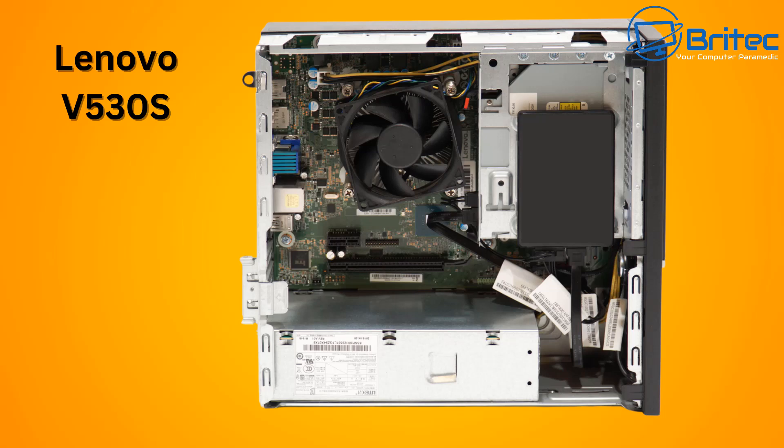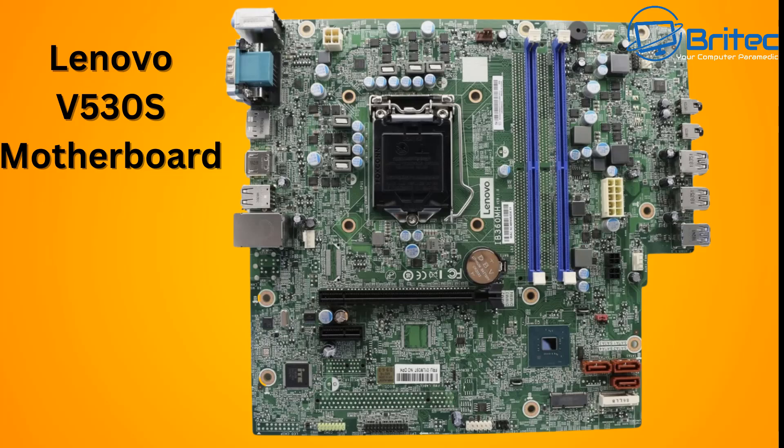If you're looking to case-swap, you've got that proprietary motherboard layout — very few SATA ports, just two RAM slots, a very basic board. There's only one fan header at the top and one in the middle of the board, so you're going to need a fan controller and hub. If you want RGB you'll need an RGB hub as well, since it won't run addressable RGB properly.